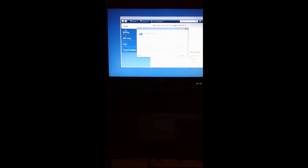So that means basically it's going to take a photocopy of the hard drive and put it on the new drive. If you go to proportional size, it's going to resize the partition and shrink it accordingly. So we're going to try it as is. It may not work, but apparently it looks like it is. Now, this takes a while. It gives you the option here to shut down the computer when you're done.